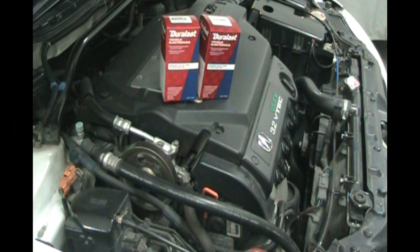Hey YouTubers, welcome back to John's Garage. Today we've got a 2000 Acura 3.2 TL that seems to be having an ignition timing problem. I've been chasing this problem for a while. The symptoms right now are that it starts up really rough. After running for a few minutes and driving down the street, it gets into closed loop condition and seems to run better, but I think it's an ignition timing problem.